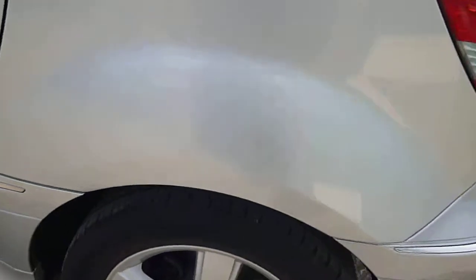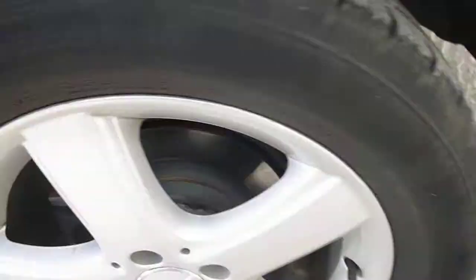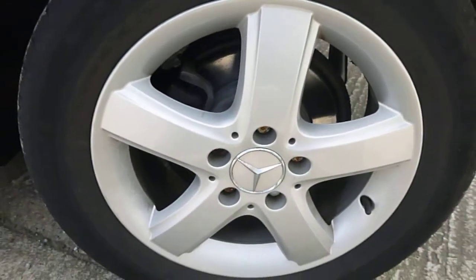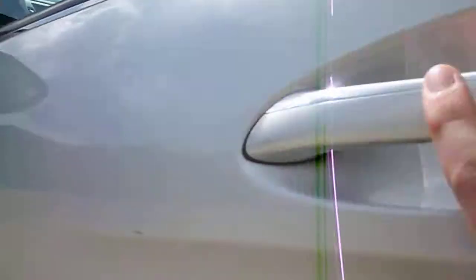The quarter's fine. The near-side rear tyre is on 4-5mm tread and there's no damage to the alloy wheel. Looking down the car you can't see any dents, though there are a few scratches and touchings to do.